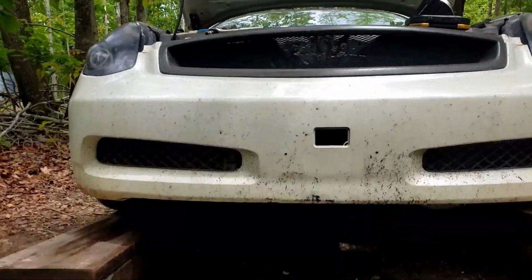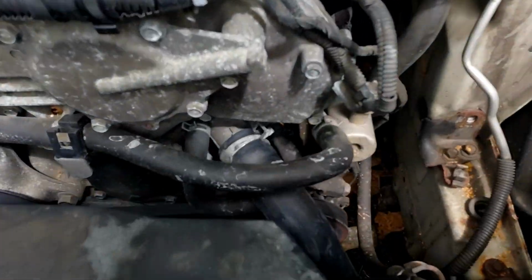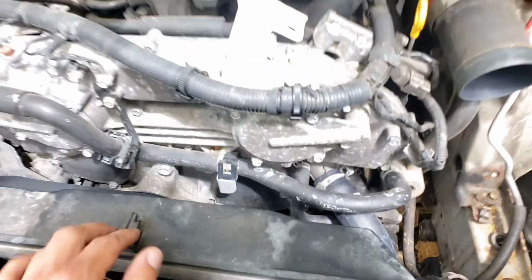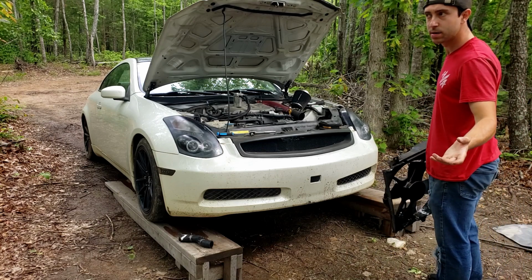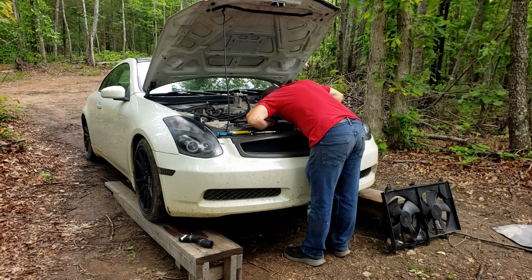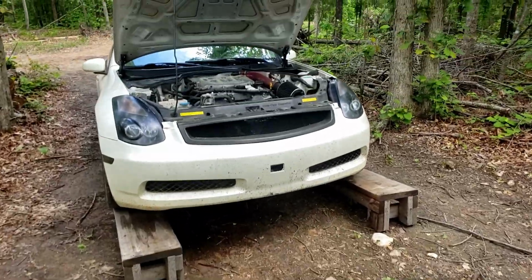Well, when I started this thing up to bleed it, it started dripping water out of the bottom, which makes me think that this coolant hose that had that tear that I replaced wasn't actually the culprit. That was just about to be a future issue. I think the radiator might have a problem. Good thing I just put water in here instead of coolant. I always do that because whenever you put straight coolant in, it's gonna leak. You put water in, it's 50-50. Might leak, might not. Yep, there's the hole. Bummer. All right, we'll pick this up next week. Parts are on the way.